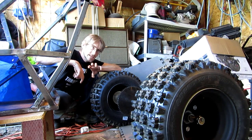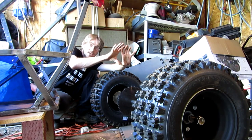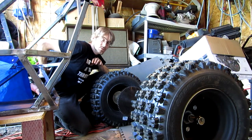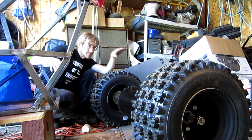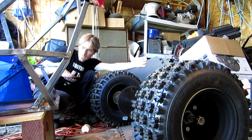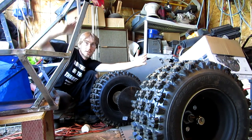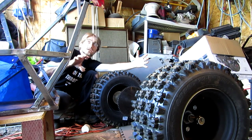I've noticed on a lot of those Manco carts — a lot of factory go-karts — where the engine is placed in relation to the occupant, the engine center of gravity is roughly where the center of your back is, between the lower and the center of your back. That's where the engine is placed. So if I were to take the engine and mount it somewhere right here, or maybe slightly a little lower, I've got where my seat's going to go and my body or anybody else's body, and that'll give me a good decent center there.